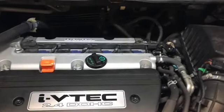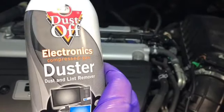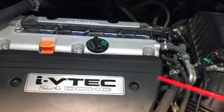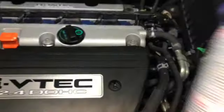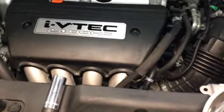Just to prevent debris falling in — this is optional — if you have a can of electronics duster or air in a can, it's not a bad idea at this step. Just go ahead and dust this off because you don't want anything to fall down into the spark plug hole when you start removing this stuff. You want this work area to be very clean.